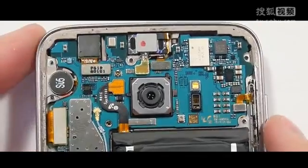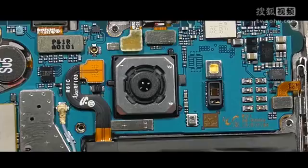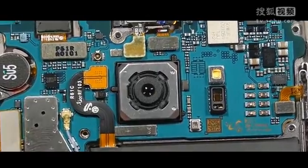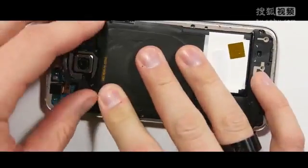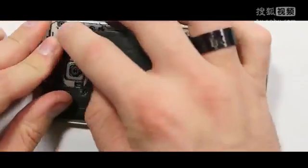There's two ways to stabilize images. There's optical image stabilization and there's digital image stabilization. The digital is just software where it takes the megapixels and kind of cuts off the corners of it and can stabilize it that way. I prefer the optical image stabilization, where it's actually a mechanical part of it with the little gyros and magnets and little rubber balls inside of the camera unit. Pretty nifty stuff.